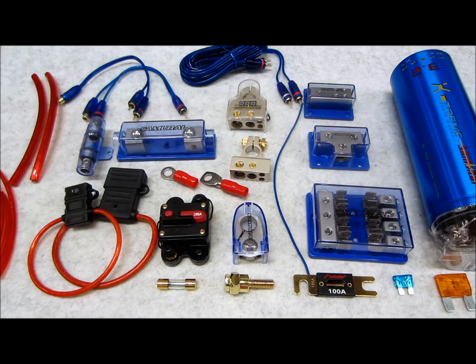It's always better to have a power wire that is larger than you need than a power wire that is too small. The price difference between the 2 wire gauges, say for instance 4 gauge versus 2 gauge, is negligible compared to the cost of having to run a second, larger-diameter wire in the future. Some reasons are: it's usually cheaper than 2 wires in terms of material and labor costs. It's also easier to run one wire as opposed to 2 individual wires, and less messy.